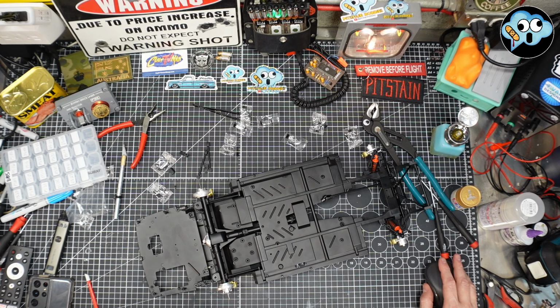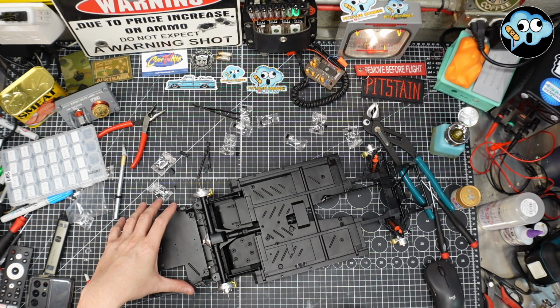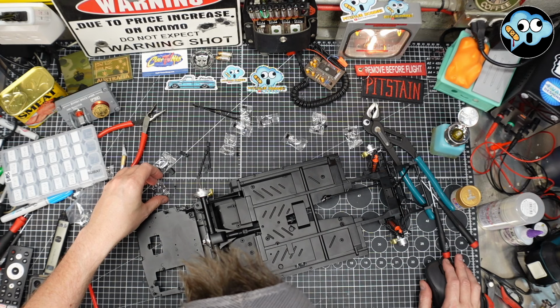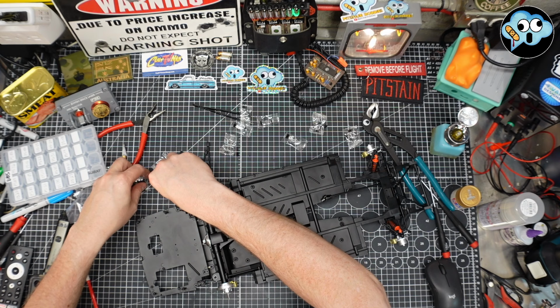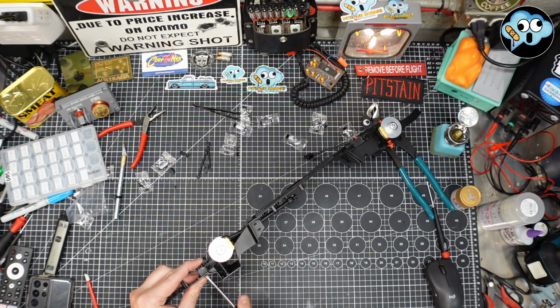Those are very cool. This is a very cool suspension. Oh, this is the anti-roll bar, basically. So instead of a metal sway bar like in the front, they have these units to control body roll. You just keep impressing me more and more, DB5. I had no idea how cool the rear suspension of this car is. I'm hardcore nerding on this thing right now. Let's get a PS25 screw in there. That is so cool.